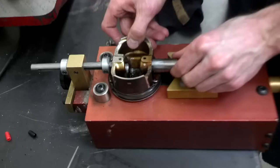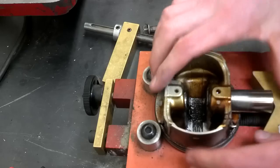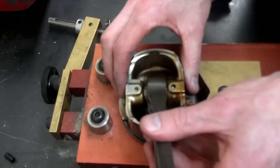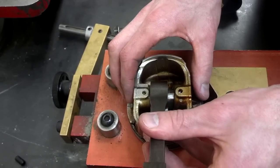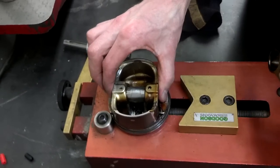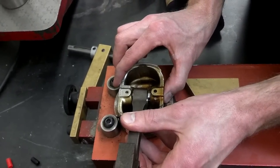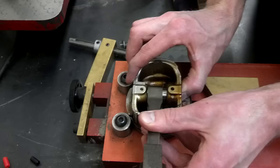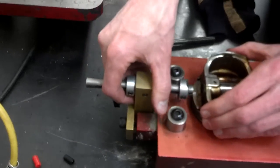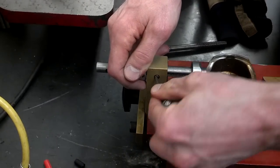The first thing you do is bring this over to this fitting here — it's got a stopper. What's going to happen is when we slide this wrist pin in, it'll be centered. But if you push this back and the connecting rod is pushed to the back of the piston while it's centered, it'll be off-center when you come back to the middle. So what we do is we center the wrist pin in the piston, center the connecting rod on the wrist pin, and then slide them back as a unit like that. So it's a little bit off-center now.